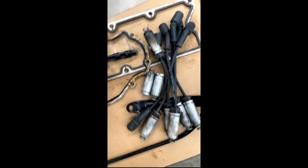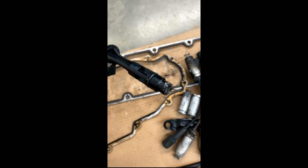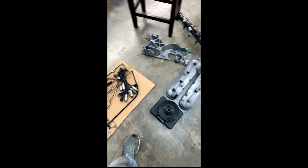Also, I wanted to show you something. Because that lifter chewed itself up, I haven't addressed this yet. You see, this is the cam sensor. It has a magnet on it. Look at all that metal FOD shrapnel that it picked up. So I've been concerned, right? Because I'm like, I don't want metal running through the block. That's going to destroy the bearings and basically trash the engine to where I got to pull it out and send it to the machine shop to completely be redone.